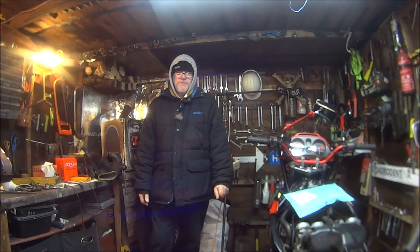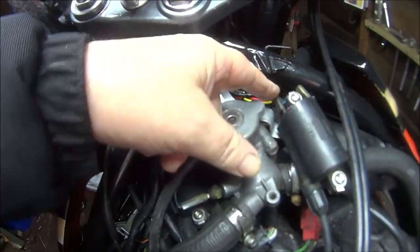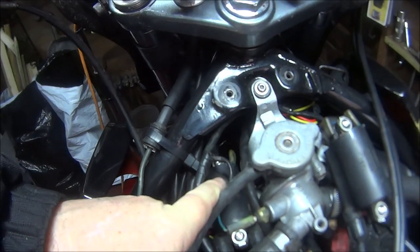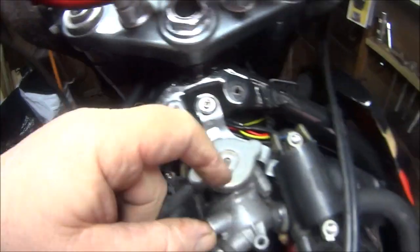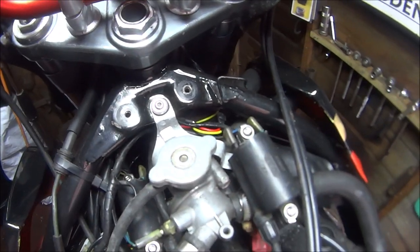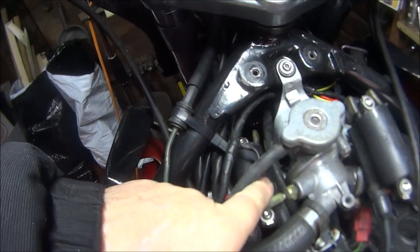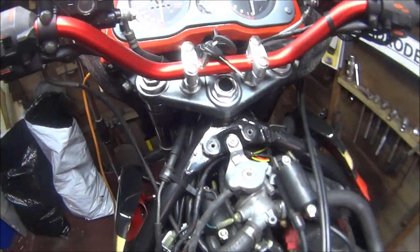How are you all doing? So somebody did come up with a brilliant idea in the comments. We're thinking this one is bad, this one is good because it's sparking obviously. Somebody came up with the brilliant idea of why not just take the terminals off the good one and put them onto the bad one, and see if that does any good. If it doesn't work then we know this one is knackered. So I'm going to have to get this coil out to get that terminal, let's get this all done and swap the terminals over.